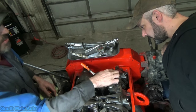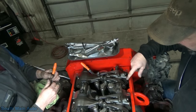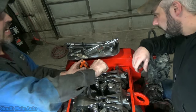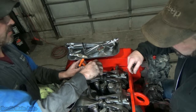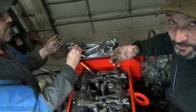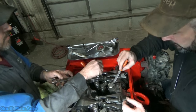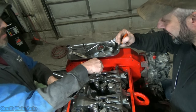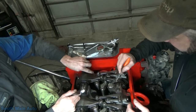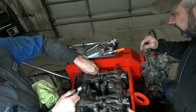We're going under the tappet — this one has a very excessive amount of play right now because this is one of the new rocker arms installed due to the bad cam. These rocker arms ride directly on the cam with a roller — it's an overhead cam and the rocker arm rides right on top. I like to just over-tighten slightly to make sure everything's seated, then bring it down to a slight bit of drag. The big debatable topic on feeler gauges is what's correct — my method is it should feel like dragging it over a magnet.